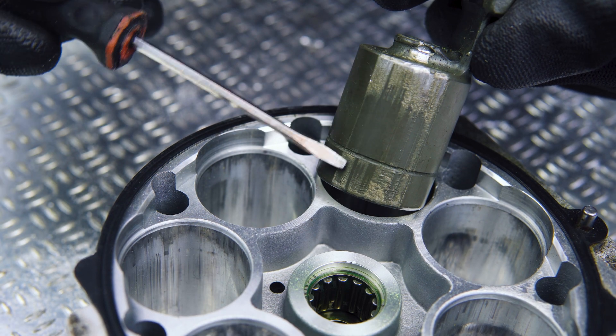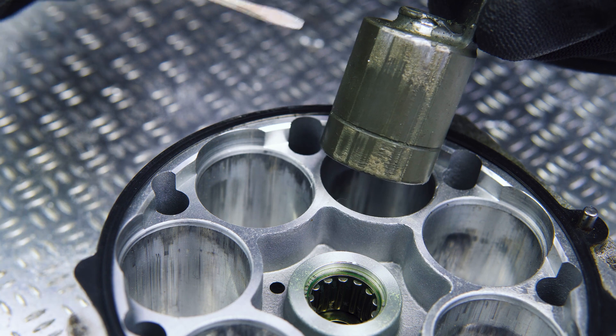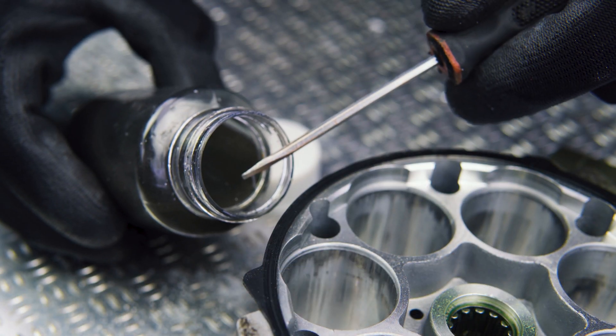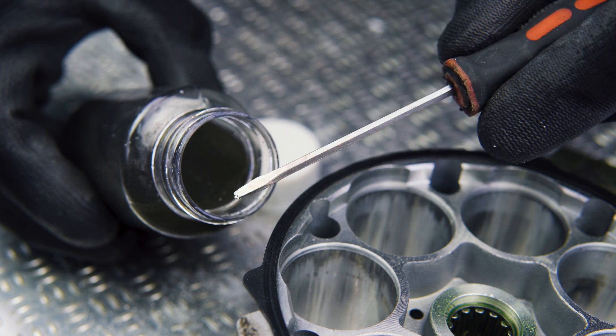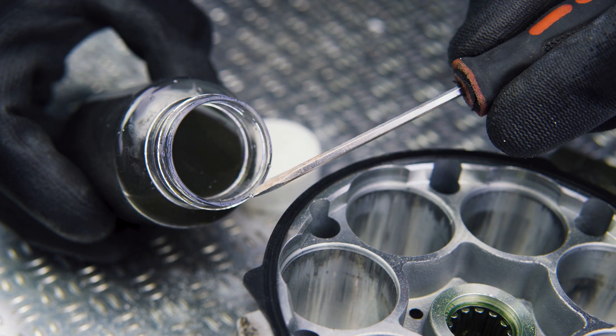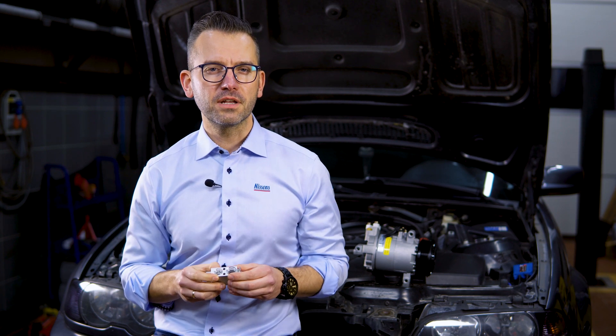Because of the restriction, the system started to generate excessive pressures and temperatures. Impaired lubricant flow to the inner compressor parts and lack of cooling led to the seizure. Please keep in mind: the TXV should always be replaced with a new compressor installation.